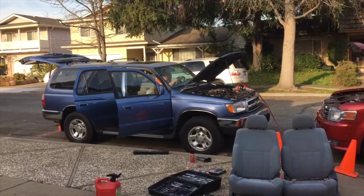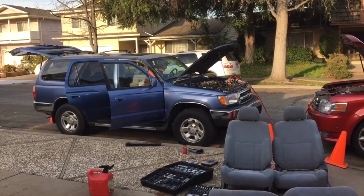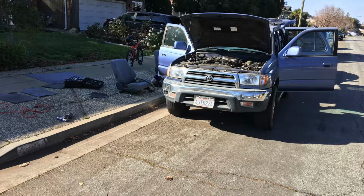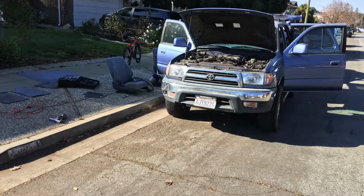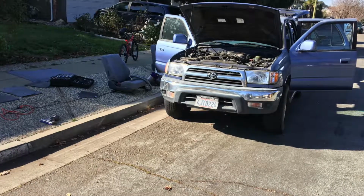And this right here is the first start I did. I had my neighbor help me jump start it because the battery was dead. Sorry for the background noise, the garbage truck was really late that day for some reason. And so the gasoline that it was starting on was actually about a year old. And also another dumb thing I did was not let it run for a while. I actually killed it right away, which meant that the battery was still dead and never got to charge it. So mistakes are made, but I learned from them since then.